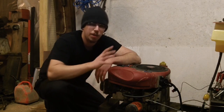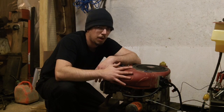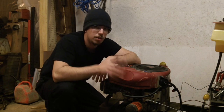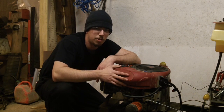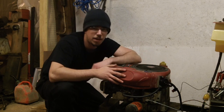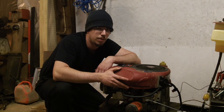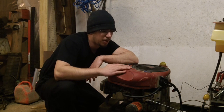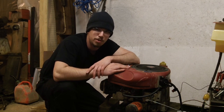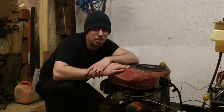As you can see, it took a few rotations in order to build up. Keep that in mind when you go to start this up — you're going to need a good battery because it takes quite a few rotations of the starter to build enough vacuum pressure to start siphoning the gas down through the new pump. As you saw, it restarted perfectly afterwards without any issue. I hope you've enjoyed this video. I'm going to continue doing a few more how-tos on this engine and then we're going to throw it on my Mudbar and hopefully make some really good footage this summer. Thanks for watching!